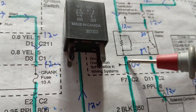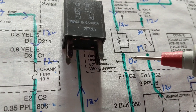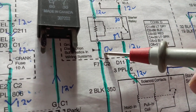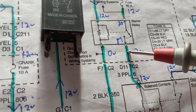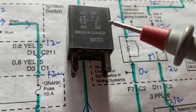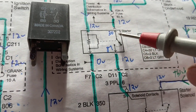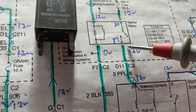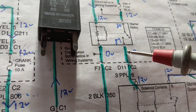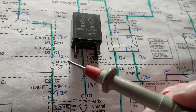If the coil is working: 12 volts here, zero volts on the ground side. If this is open, I'll have 12 volts here and zero volts on the battery side — so how do I know if it's working or if it's an open and I'm just measuring zero? What you can do is go to the load side: terminals 30 to 87. If I measure 12 volts there, that tells me the relay contacts are closed and the coil is working — there is no open in the coil. Number two: to confirm the ignition switch is good, measure voltage at the fuse — 12 volts there means the ignition switch is good when cranking in start position.